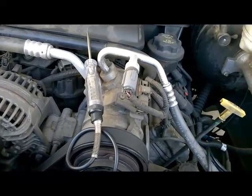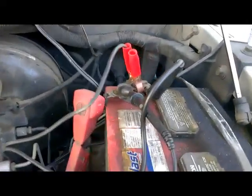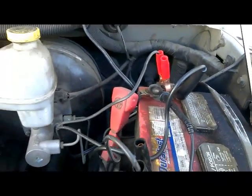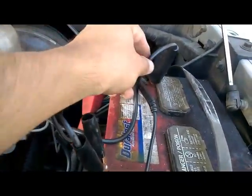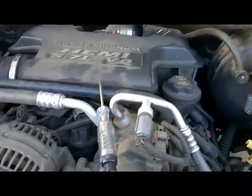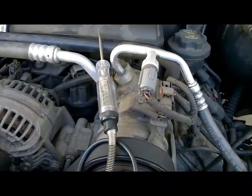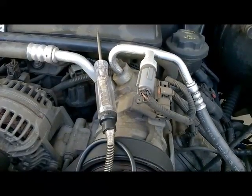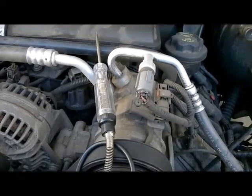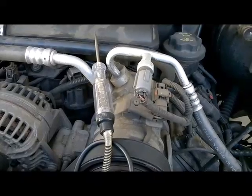In this case, this vehicle is a power side switch. It means our test light will be connected to our positive battery post, which is connected already. Since it's a power side switch, if it was a ground side switch, then our test light would have been connected to the negative battery post. So that's very important, guys, to know the circuit design, because if you don't, and you perform this manual function on the EGR, you could actually cause damage to the driver on the PCM, and that's going to cost you more money to actually fix.